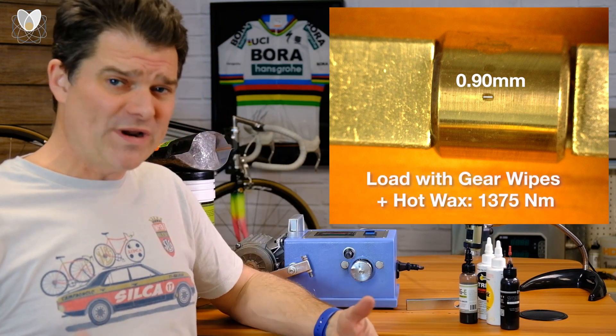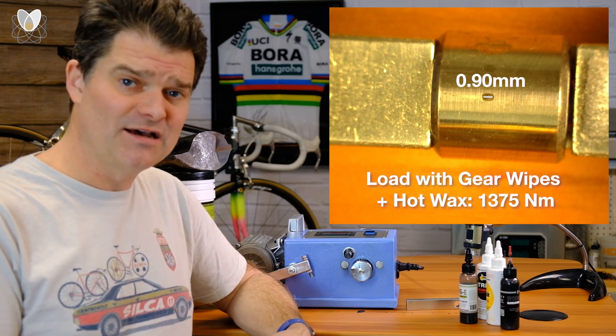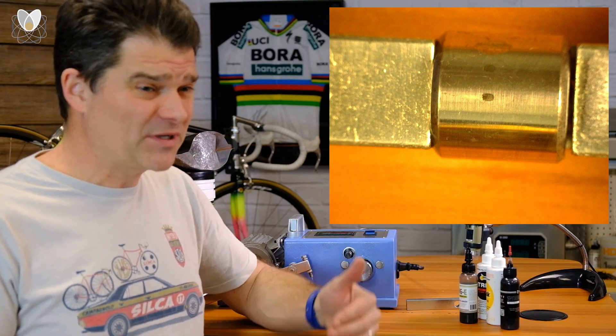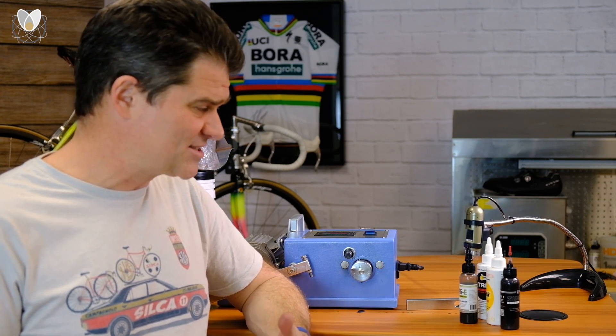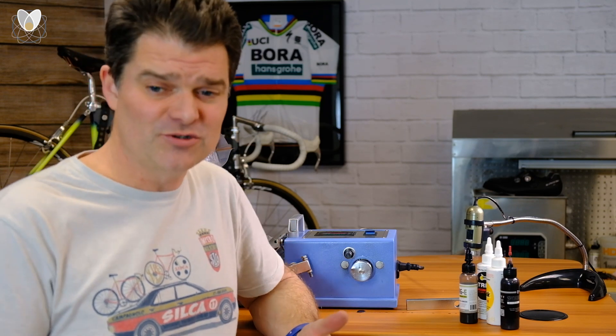You wanted it — ProGold, ProGold Extreme. We did it. I would say not a terrible product — not nearly what I expected compared to the friction results as reported by VeloNews and Friction Facts, which would have led me to believe that when you're in the 8-watt friction range, you're typically quite a bit higher wearing. So yeah, there you have it — twice the wear, almost twice the friction. But I think it's about $10 a bottle, probably half the cost of our stuff — and I would say not bad. Be sure to like us, share us with your friends, leave below other lubricants that you want to see. We will test them right here in real time so you can see exactly how things compare. We will see you next time.